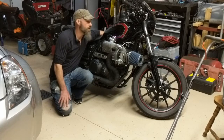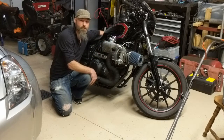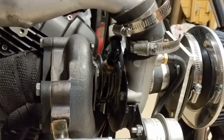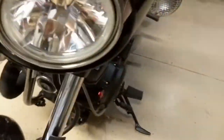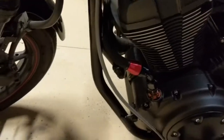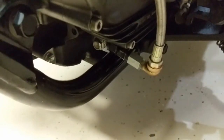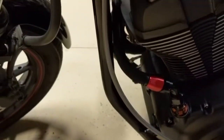Hi folks, this week on My Cramped Garage we're going to talk about oil lines - send and return - the intake, and the electronics. Here we have the send line, which uses an AN fitting 90 off of the braided hose that came with the kit. All items will be in the description. A lot of people asked where to tap off the oil line - I found a spot right at the bottom of the bike using a banjo bolt, fitting, and adapter. Measured about 60 psi of oil pressure going into a restrictor, so it should be fine.